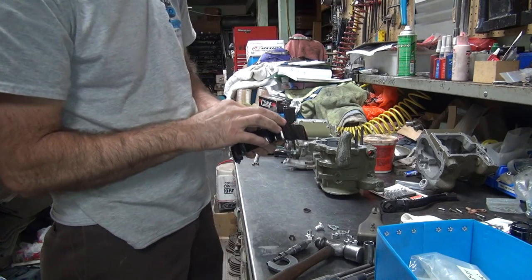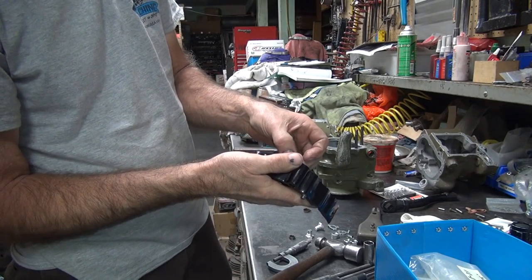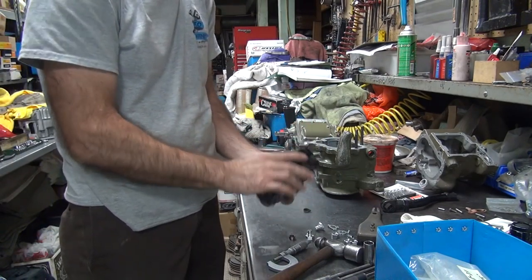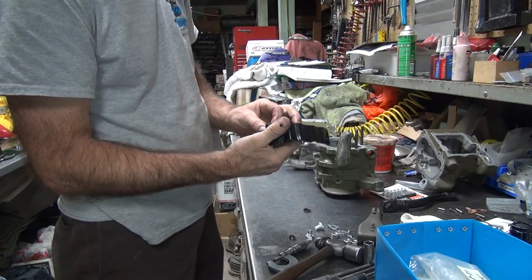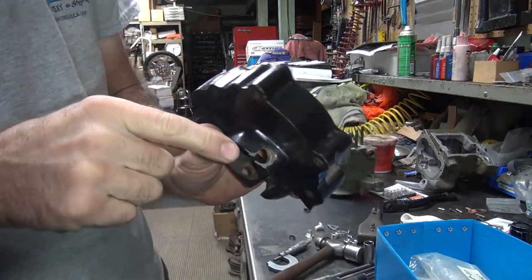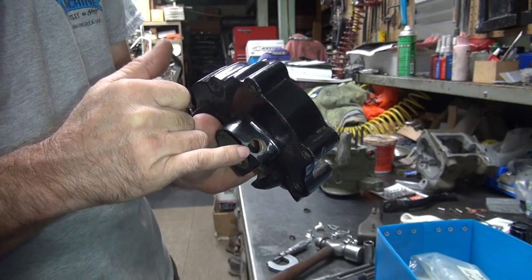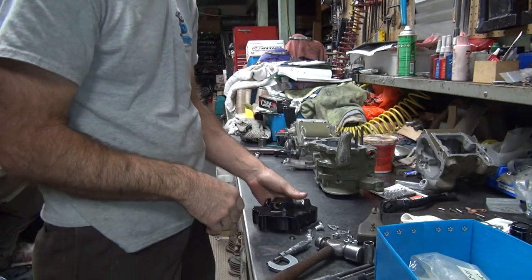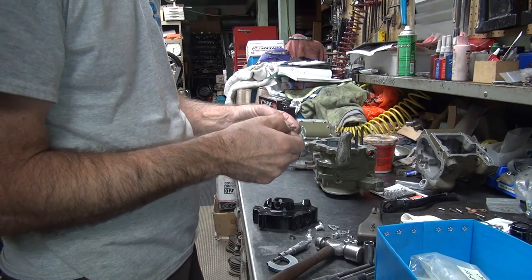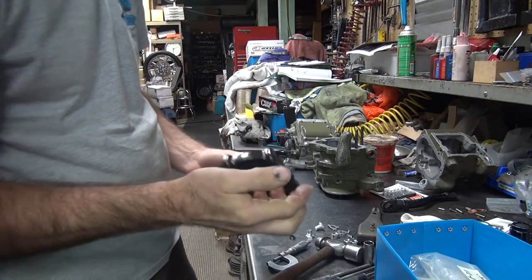Now you're going to weld it and burn the powder coating off of it. See, the bushings aren't even the right size. That's why it's welded. See the bushings floating there? Not even made the right size. That's why they welded it in. See, they machined them because the case was so sloppy. It's machined to have a pressed-in bushing. But the bushings are loose, so they welded them in because they were loose. Oh, brother. That's why they welded them. So that's why they look like they're replaceable, because there's no reason to put a bushing in there like that if you're not going to...